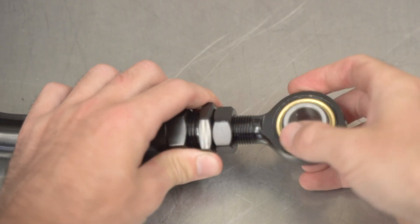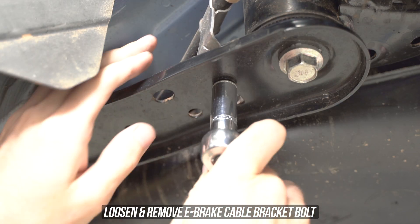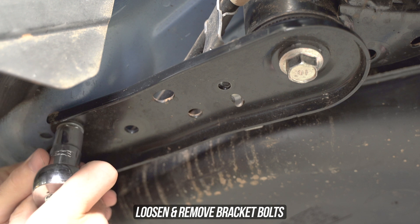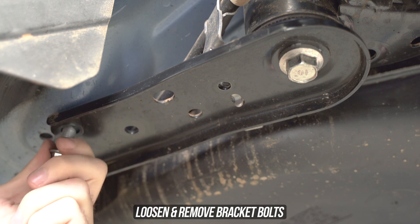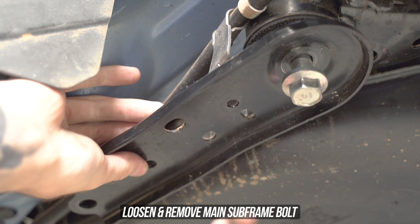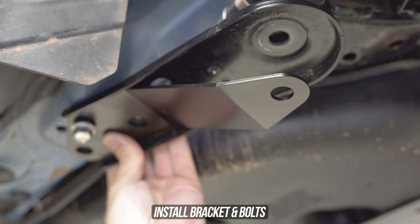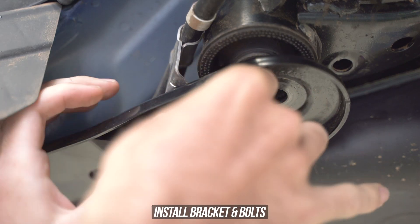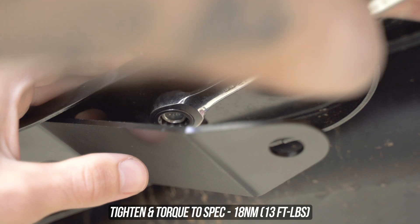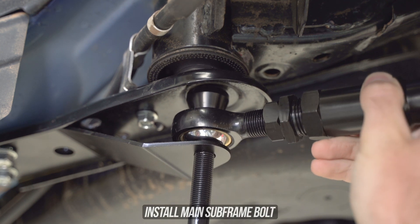Now that we're locked, cocked, and ready to rock, let's head back to the car. First, remove the little 10mm holding the handbrake cable to the subframe bracket. Head north and whip those two bolts out of the chassis that secure the front of the bracket, then whip the bolt that holds the subframe bracket to the subframe. Get your beautiful shoehorn piece and mate it with the OEM subframe bracket, turning this sucker into a slick and strong double shear mount. Install the two bolts in the front of the bracket, leaving those hand tight for now. Line up your handbrake cable and whip that 10mm bolt back through and tighten to the spec shown on screen. Now get your traction arm — with the thick spacer on top and thin spacer on the bottom — and slide it into the double shear mount.